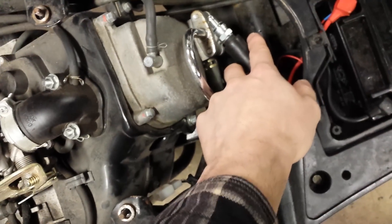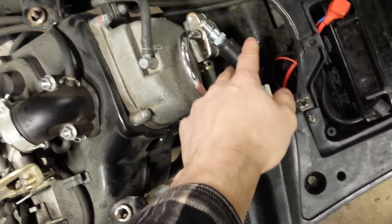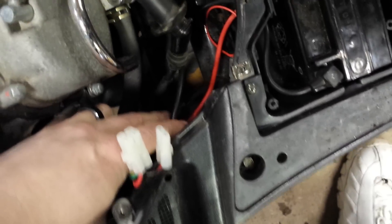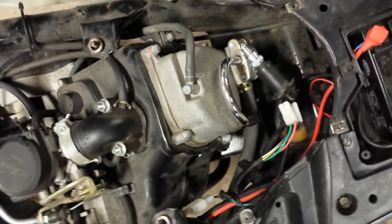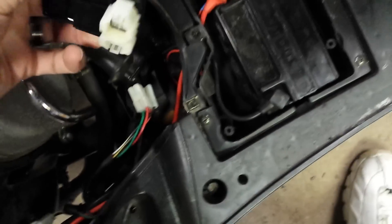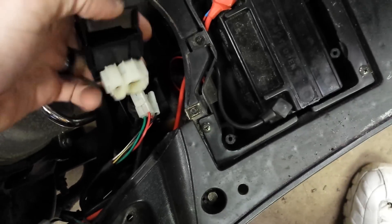Before, when I turned it over I had no spark. I have it grounded to the motor. Down here is where my CDI box was, on the sole clip in here. So I'm going to install the new CDI box — I'll try to do it one-handed, whether it works or not I don't know, and we'll go from there. Here's the CDI box.